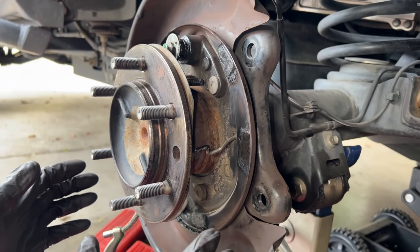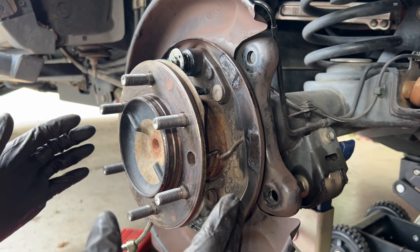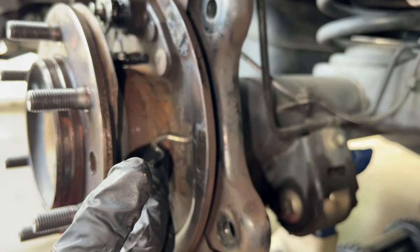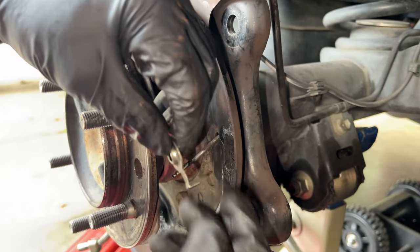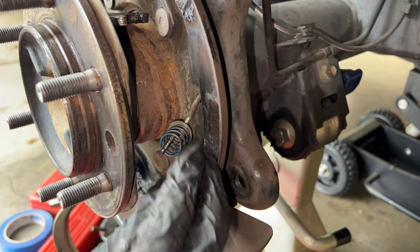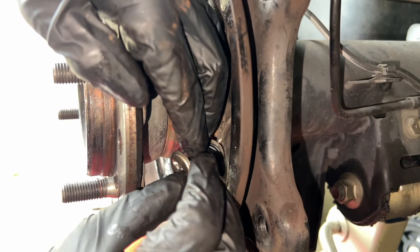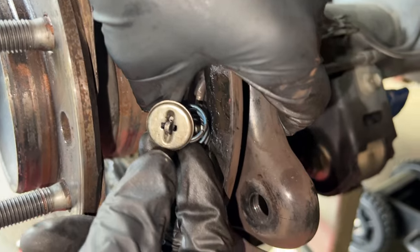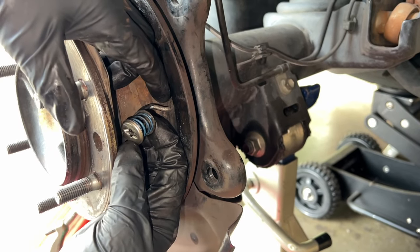I have the brakes all disassembled — I didn't bother showing it because you saw it in part one. What I'm going to do is preassemble the plates and springs onto the pins. I get this hooked pin in first — the hook has to face towards the backing plate — then I put the spring on, then the outside plate, slide it through the slot, rotate it 90 degrees, and lock it in place. The pin is now locked into the outer plate.